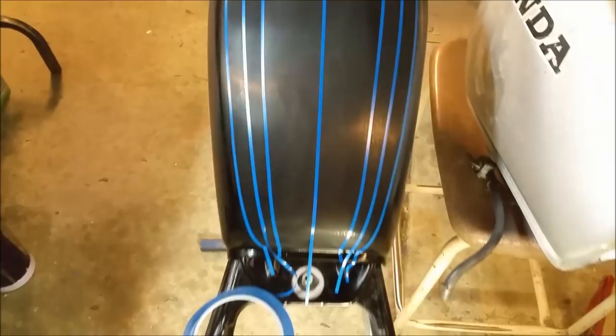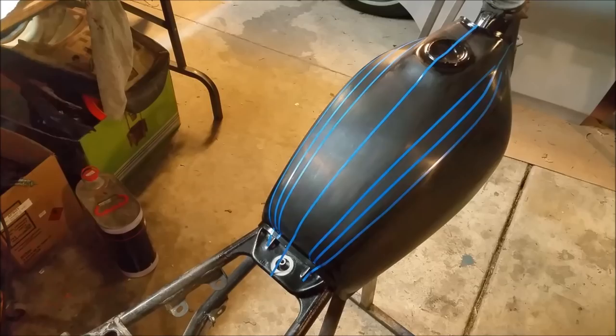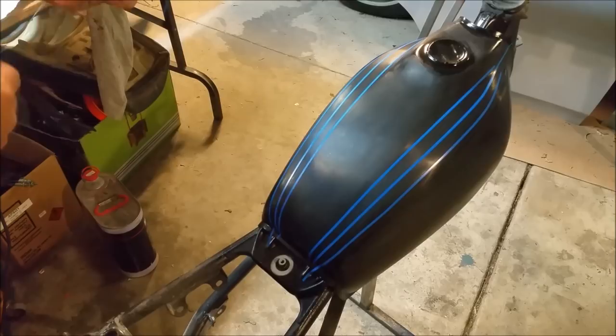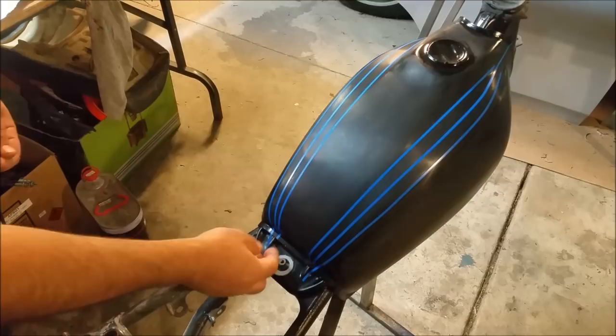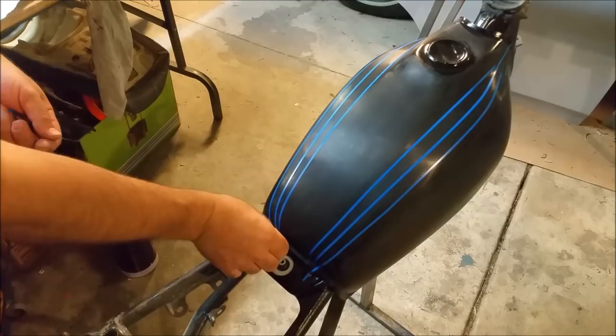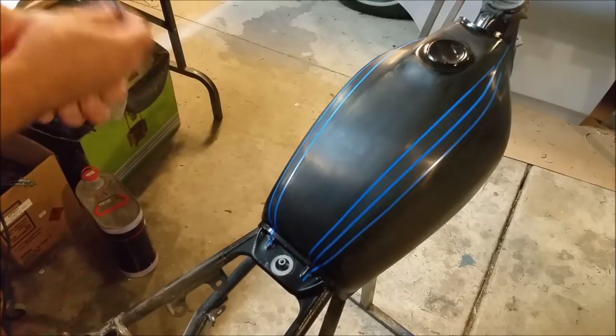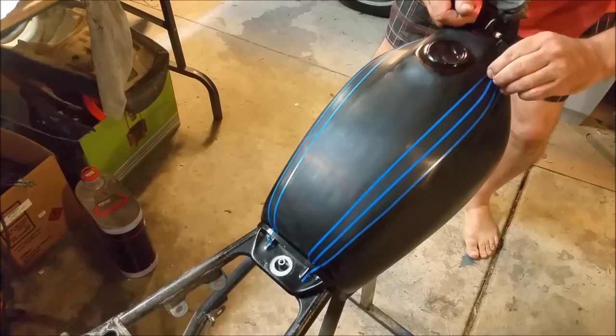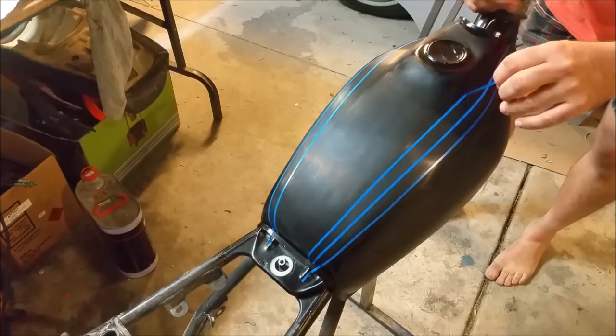I'm almost there. Notice that I've color sanded but not completely. The reason I've color sanded but not completely is because I want the tape to give a clean line, right, which it's going to do. So we need to take this inner one off now. This stuff's great. This is about $9 a roll, this striping tape. And so then, after that, I can't get it off from the bottom. We can mask this whole black section off and start throwing some silver down.